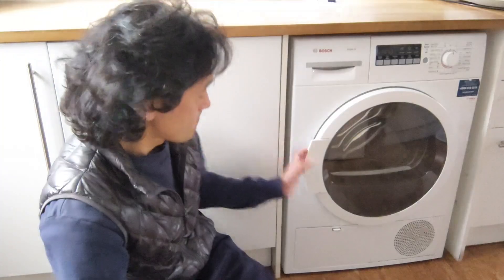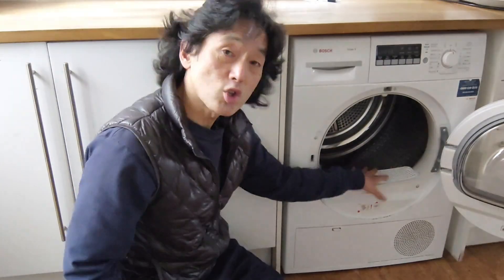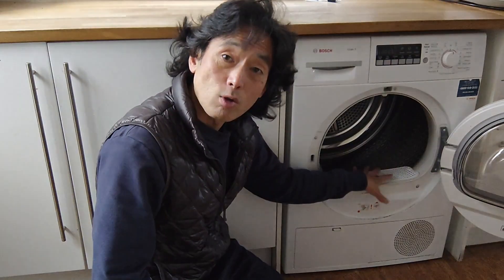Anyway, the dilemma of this machine is: the pressure inside the drum has to get higher, otherwise the compressed heated air cannot be pushed downwards through this duct. Without high pressure inside the drum, the air cannot be pushed onto here. So the machine — the tumble dryer system — doesn't work. Pressure increase is necessary inside the drum.